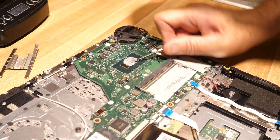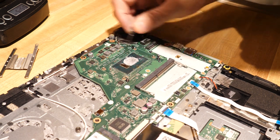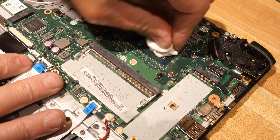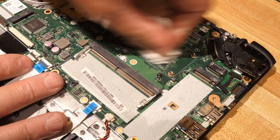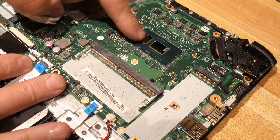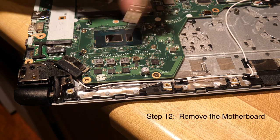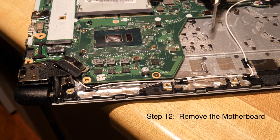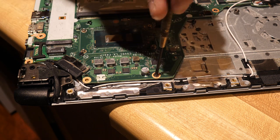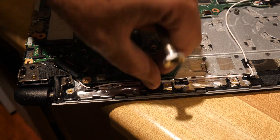Can't really get to it with a flathead, so we'll attack that with a different method. I'll just sort of clean it up a little bit with a paper towel and wipe it down. You can see where we need to go right there. I think what I want to do is remove the motherboard so I can see what's underneath. There are a couple of screws on the motherboard — they're pretty evident — so just find them, unscrew them, and you should be good to go.